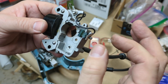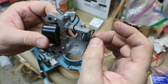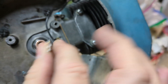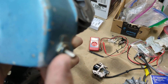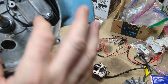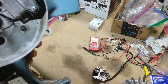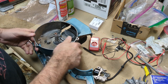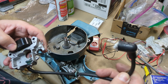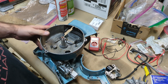It's just a junction spot is all this is. We could take it off and twist them together with a wire tie, but we're going to use the original mounting points. So there's going to be one here for the coil, and then these two wires — this one's coming from our chip and that one's going to our kill switch. The way this works is when your engine is running and the magneto is spinning, it's charging up this coil with a magnetic field. Normally the points ground out and short circuit the coil to earth ground, and that's what causes an induction of energy into the secondary coil — the high energy part — and that's where you get the spark. So it's actually grounding out that primary coil, and that is exactly what the chip does — it just does it electronically instead of points.